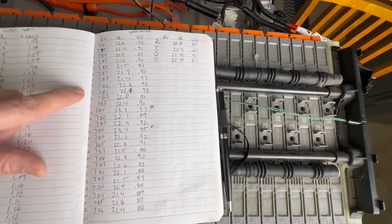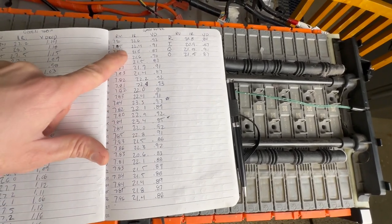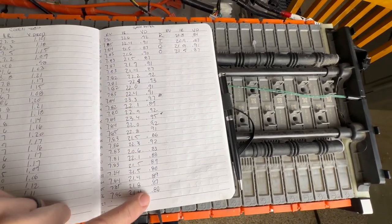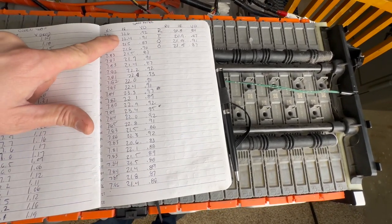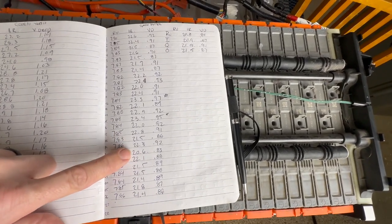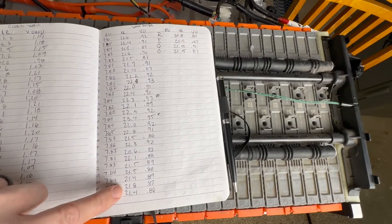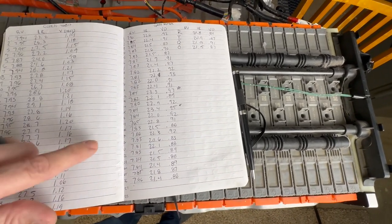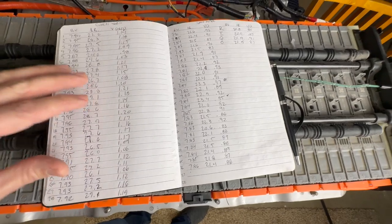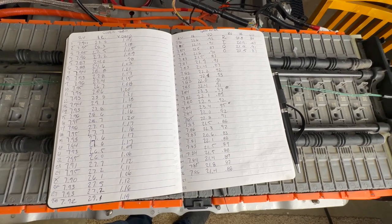As compared to notes over here. This was a spare battery that I was actually building for a friend of mine. You can see I measured my resting voltage, my internal resistance, and my voltage drop. If you look at these particular modules, everything was under 1 volt. And even though the internal resistances were a little higher than I wanted, this was before I conditioned, so this was pre-conditioning. And what ended up happening is all these resistances fell below into a usable threshold of what I would really like to see. Now, if you are unfamiliar with what reconditioning does, let me explain that to you in just a moment.